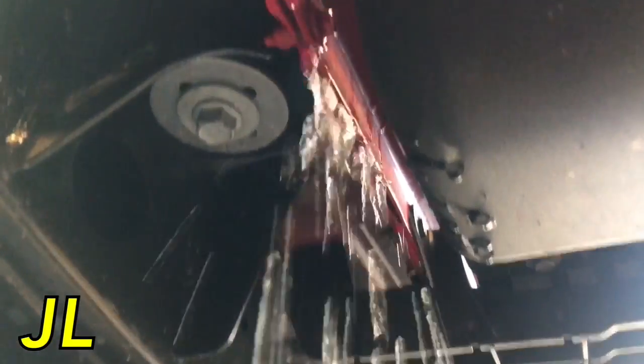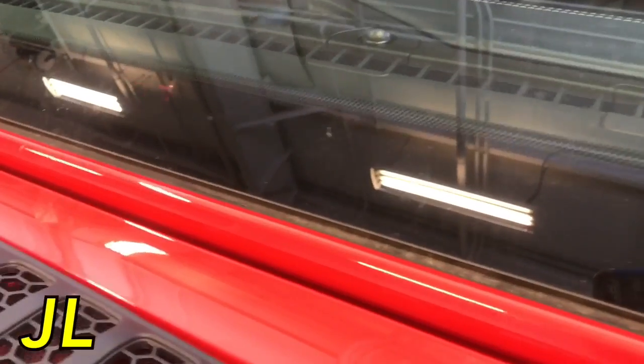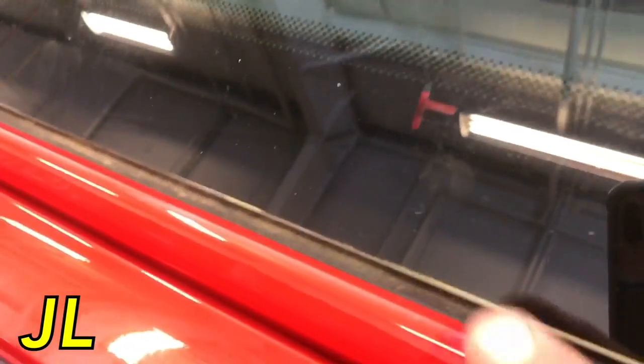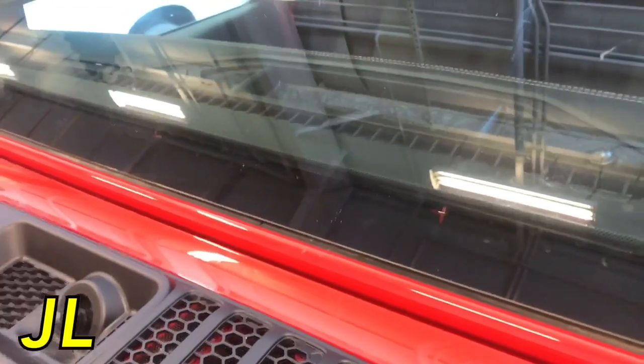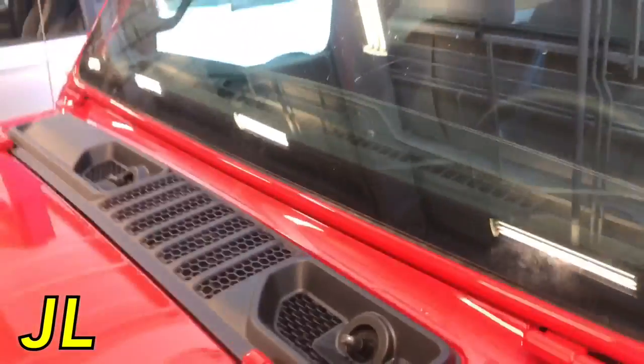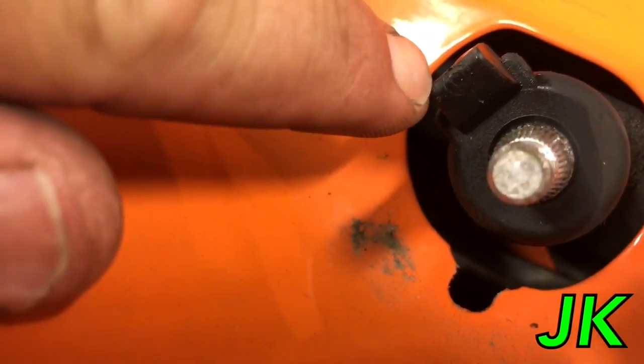What you're seeing here is a nice healthy flow. When I was putting this cowl and wiper arms back together, I noticed the glass has some markings that the JK does not have — these markings are for windshield wiper alignment. The JK doesn't need them because it has a keyway on the wiper shafts. On the JL there is no keyway on the wiper shafts, so you need the windshield alignment markings instead. Interesting fun fact.